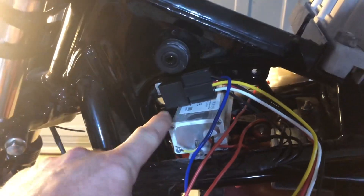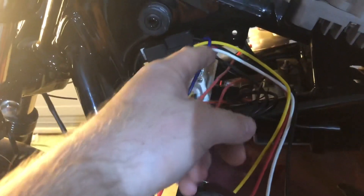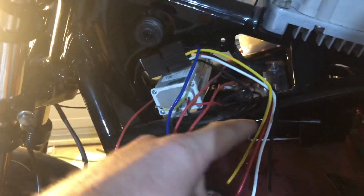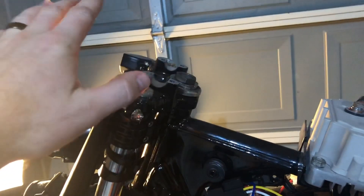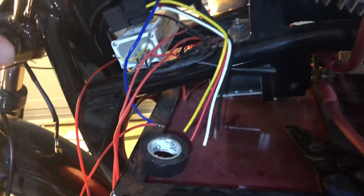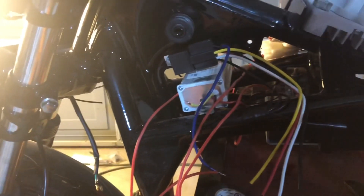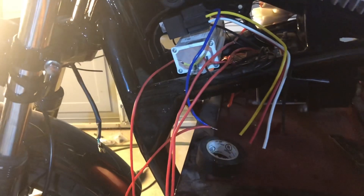We got ourselves a 40-amp relay and I'm wiring it in so that on the key switch this will activate and then all the systems will turn on. So you won't have that volt meter and amp meter active all the time - it'll only be active when the key's turned on. It'll also control the 5-volt system so that the GPS display up here only turns on when the key turns on. So everything's controlled normally as a key switch would operate. I'm going to go ahead and put the camera on time-lapse so I can get this captured.